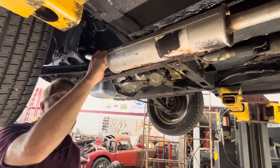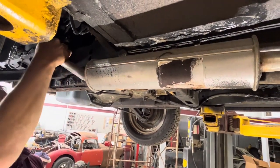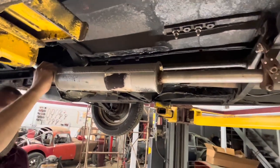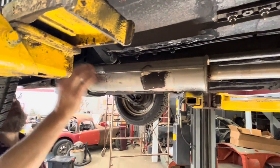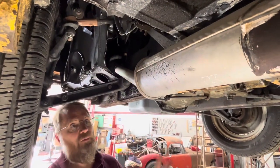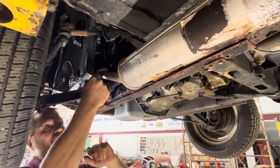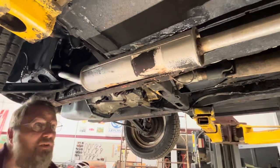Now the exhaust leak — see how much it moves. You can also see it's hitting on the chassis here. The whole exhaust system is sitting way too low in the car, so it really needs all new hangers put on it to tuck it up a little tighter to the chassis so we can get it to not rub here and sit better on the manifold. We can clamp it so it doesn't move around so much, because as long as it's moving around like that you'll never get it to seal up, and hitting there is going to just keep shocking it. We'll have to adjust the positioning to keep it from leaking.